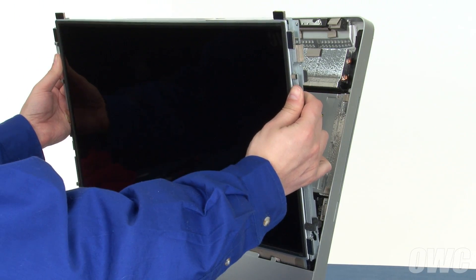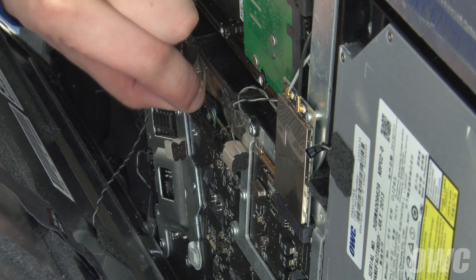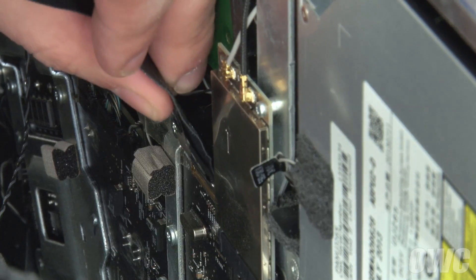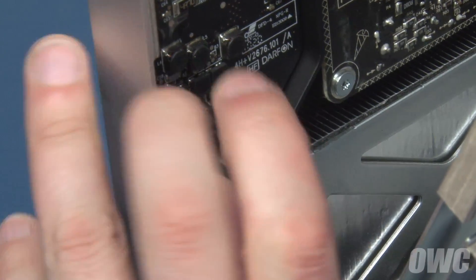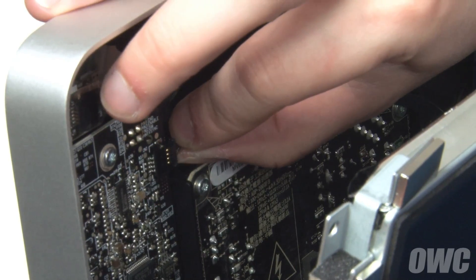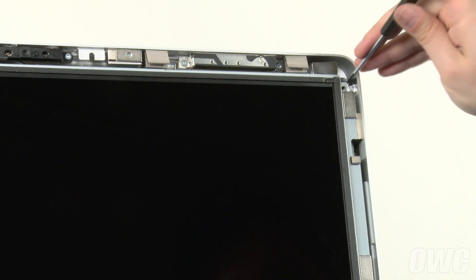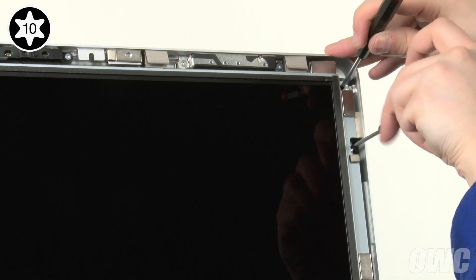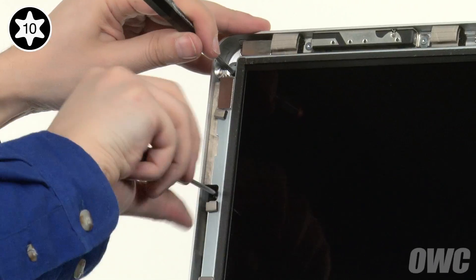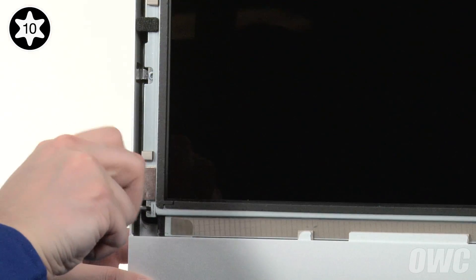You can now set the LCD back into the iMac, once again being careful not to touch the screen itself. Reattach the LCD temperature sensor cable by simply sliding it back into place. To reattach the DisplayPort connector, first make sure the handle is flipped upwards, then slide it into the connector and flip the handle down to lock it into place. Reattach the backlight power cable on the lower left by simply sliding it back into place until it clicks. Finally, plug the vertical sync cable back in. You can now lean the display back so it lays flat. Take a narrow screwdriver and slide it through the top screw hole in the display and into the hole in the iMac, use the screwdriver to align the second screw holes and insert a screw so that the screen doesn't fall. Repeat the process on the other side, then replace the remaining screws and tighten them all down. Use your tweezers if the magnets make installing the screws difficult.